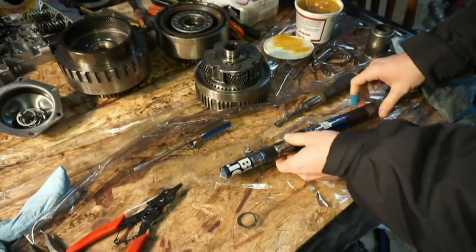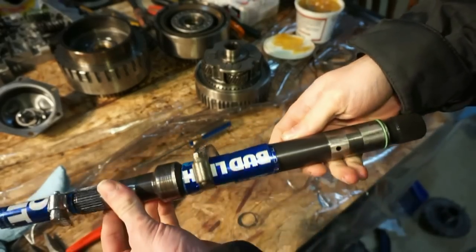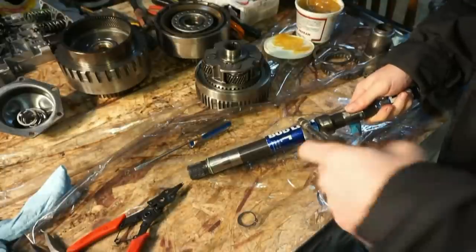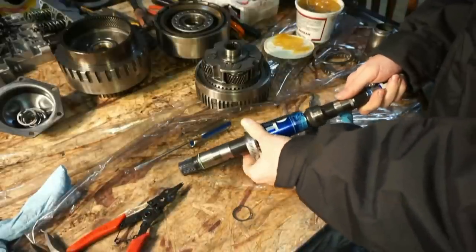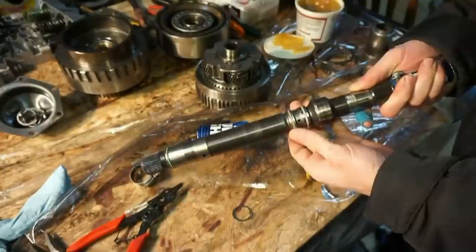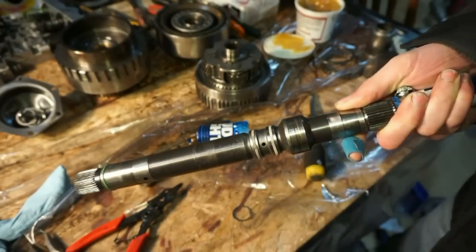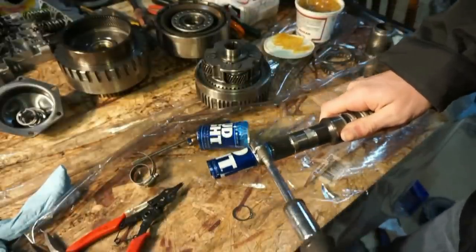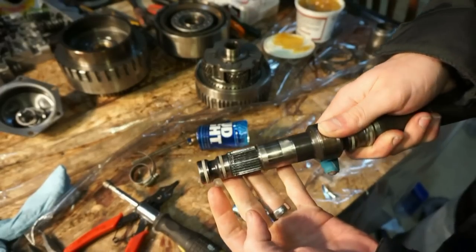Okay, this clip is actually the next day because I decided to use this custom tool that I made to compress those Teflon rings. So it's pretty high tech. Just want to see how well it worked. I say how well it worked because I know it worked, right? It's gotta work. They're a little wavy yet, but they're not very loose on there anymore. So they're nice and tight. It works maybe not better, but it's better than buying a $200 tool that I'm gonna use one time.